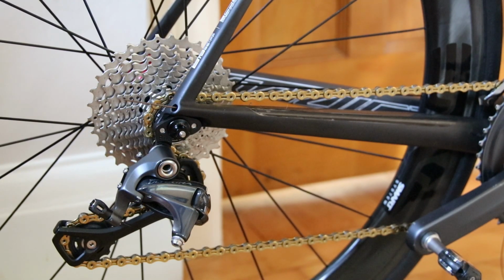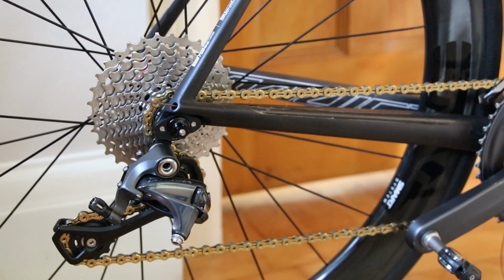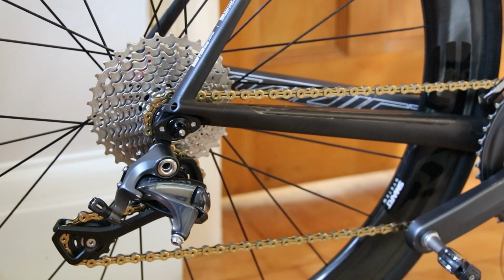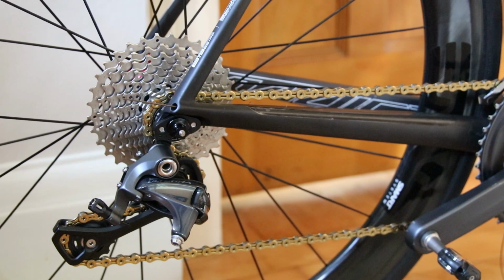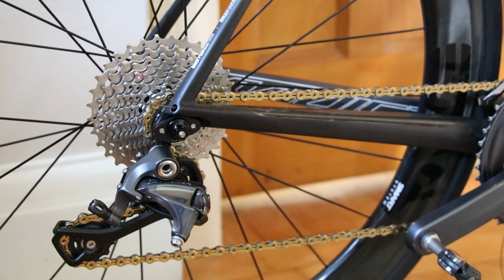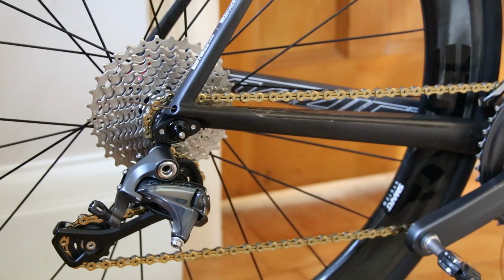That took literally half an hour, from unwrapping the bar tape and taking out the old gear cable, to cutting the new outer cable to size, threading that all back in, and threading the new cable down through the down tube and out the bottom bracket. I was being very careful, and it still only took about that much time. I was really pleased with how things were going. But then I spent a couple of hours doing this next bit, and try as I might, I could not get the gear cable to come out of the little hole in the back of the frame where the cable outer and ferrule go into.